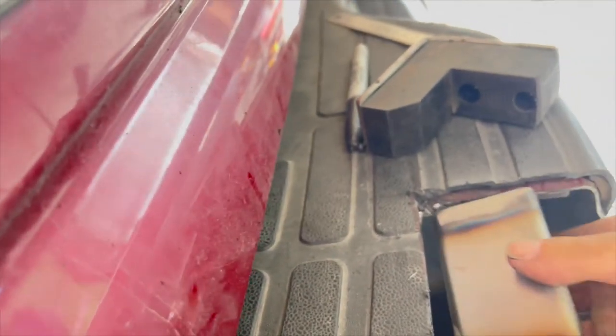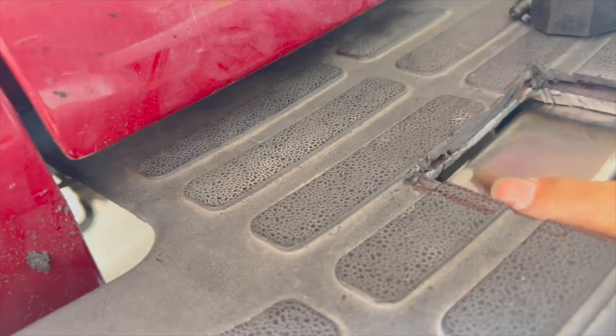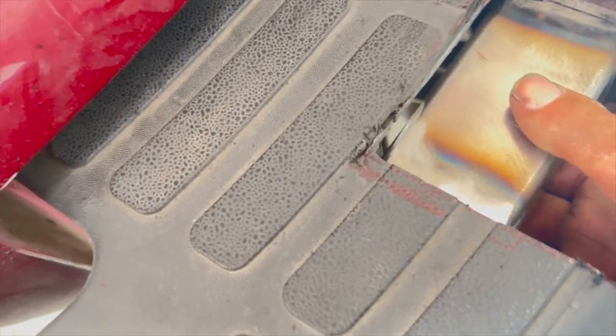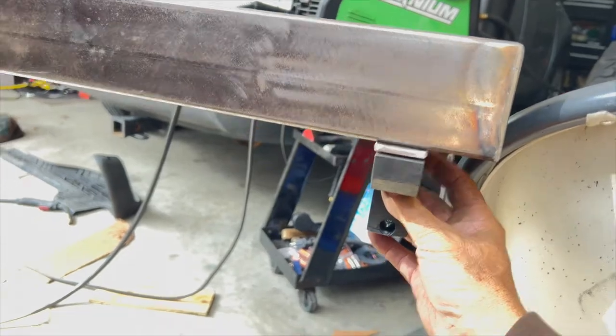I'm pretty lucky in terms of the height — the top of this needs to be the bottom of this metal plate, which is great because I can weld it all the way around the corner, across the back, and on the top, and then weld it inside this bracket. I'll snip the corner — that's going to fit in there perfectly. I'll pull the bumper off and take the plastic off so I don't melt it, then weld the L-stop on the bottom of the swing arm and weld the latch on to the face of this block. Then I can work on the tire carrier and I'm pretty much done.